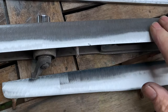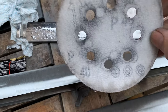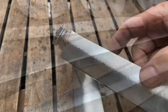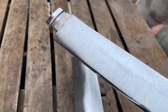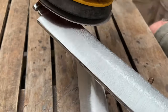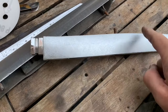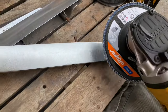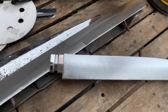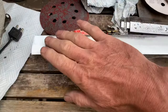We've finished going over these with the angle grinder - there are quite coarse scratches in there. I'm going to start off with P40, step up to P60 and P80. As soon as you start going over with the orbital sander, what looks to be quite nice shiny metal will start to look really rough again, but don't get depressed - as you work through the grits that roughness will disappear. I'm sanding for less than one minute with each grade, using a smooth backwards and forwards action. With the angle grinder, keep moving - if you stay in one place you'll wear in grooves.